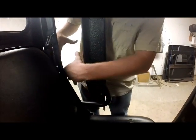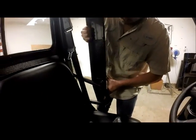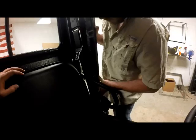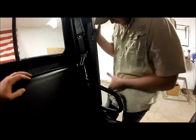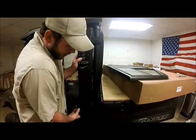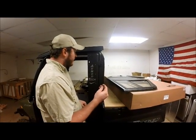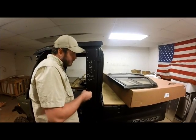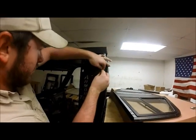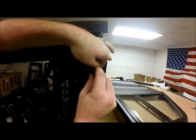That will allow us to slide our jam up, because we can't reach our bottom because of our seat here. And we'll just work it, sliding our jam and scooting it up the bar until it fits in place. We want to align our roll bar here with our outline profile of our jam piece here. And then we'll take one of our 5/8 bolts, or short bolts, and our lock washers and nuts, and we will go ahead and get those started in here. And I like to hold a little pressure on mine with a finger.